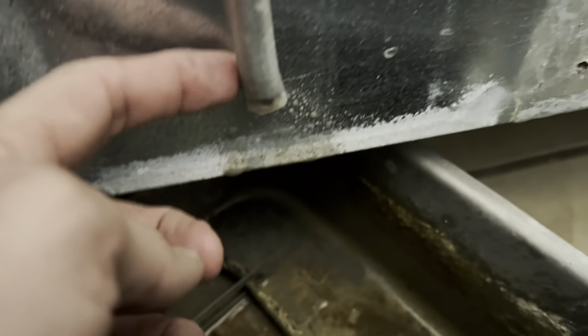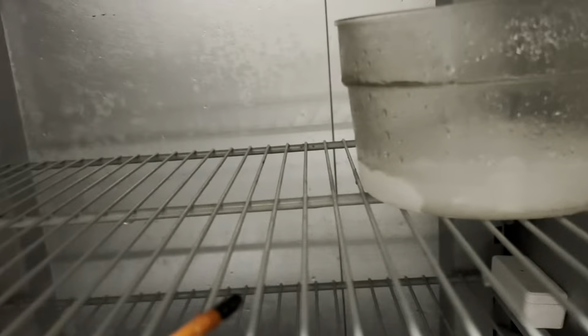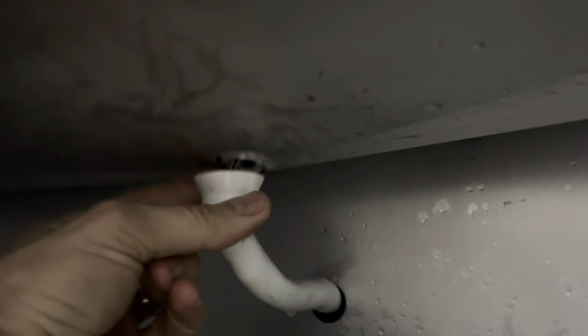I'm going to close it up and put it in a defrost. I'm not going to connect this yet because I want to watch it physically drain. I just turned the compressor back on — I left chunks of ice in there and I actually want that. I'm going to get this wiped down so it doesn't drip, but in here — and I've done another video on this — this happens a lot on these units. This has to be siliconed up with a sealant that's going to hold at 20 below, which they do sell.